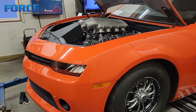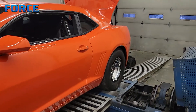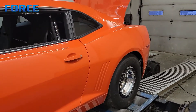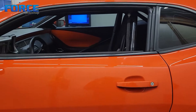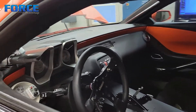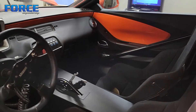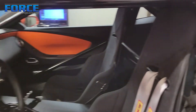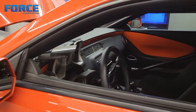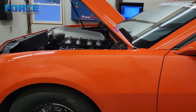My customer just picked this thing up. Had to change a couple rocker arm lifter preload adjustments, but we got it here on the dyno, ready to make some pulls. It's very much a race car — there's not any idle control. Looking at the programming, there was no coolant temp enrichment or any of that kind of stuff. It was definitely intended just as a race car.